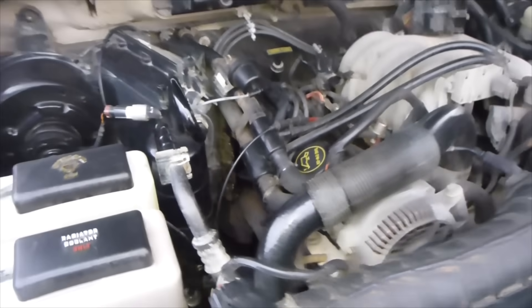That's Cylinders 1 through 3. Let's go to Cylinders 4 through 6 on the driver's side. Looking into Cylinder 4 — piston is all the way down, there's definitely carbon buildup on the edge of the piston, and on the right side as well. Moving to Cylinder 5 — wow, there's a good amount of carbon buildup here. At the edge of the cylinder, that's where most of the carbon is building up. You don't want the carbon to keep building on itself, because it creates mounds that are bad for compression ratio and detonation. Cylinder 5 is going to be a really good cylinder to see if Gumout really works.